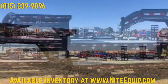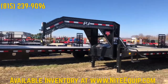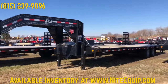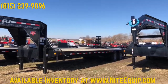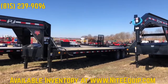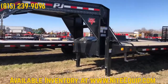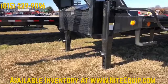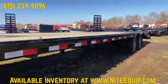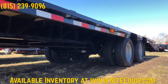And then we're getting up to our 12,000-pound tandem duals — so obviously you can haul more weight. We like to put the two Jost heavy-duty semi-style jacks on there. Those are two-speed. They're a lot heavier duty because when you get into a 12,000-pound axle, most of the time you're looking at a longer trailer with plenty of weight. The two-speed function — I prefer it over the Bulldog two-speed function.